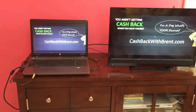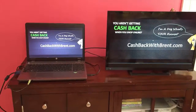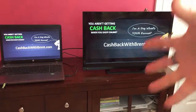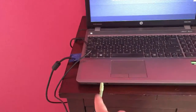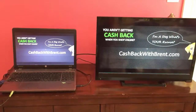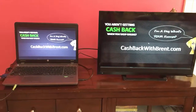One thing to remember about this is, if you don't want to convey video — for instance, if you're just wanting to listen to audio from your laptop through your TV and your audio setup — all you need is this audio cable right here. It goes from here to the back of the TV audio input, and then you can play all of your music from your laptop through your TV system. And that's the second option.